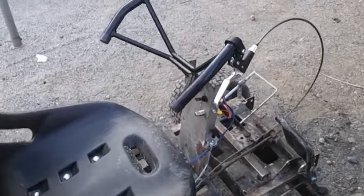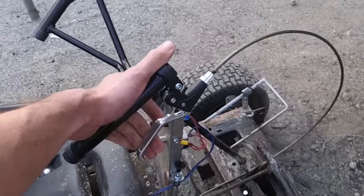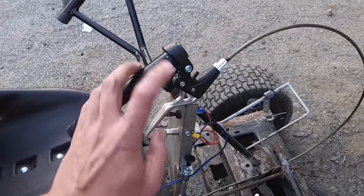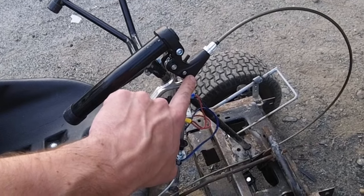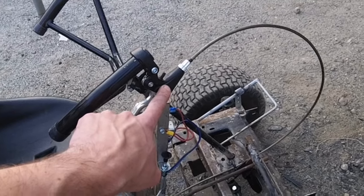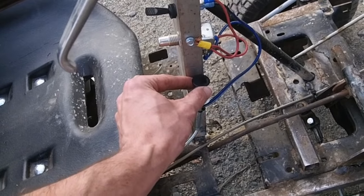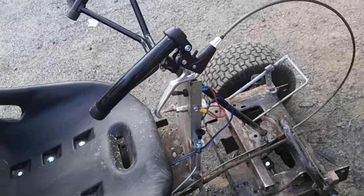As far as the rest of the front is concerned, these are go-kart steering grips off of BMI Cart. This is just a regular clutch handle for a moped — I grabbed it because they seem to be a little bit stronger based on Amazon reviews. The problem is it doesn't have enough throw for where I ended up attaching on the engine in the back, so I'm going to have to change where it's connected to the opposed twin. That just loops around and goes underneath, then comes through the side along with the choke cable, which I've got mounted right here. You pull up to choke, push down to release, just like a generic setup. There's another video covering all the wiring, so we'll leave that alone for now.